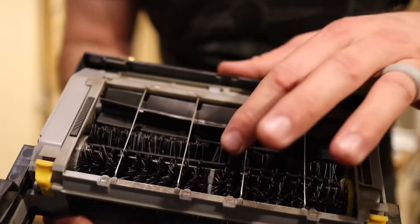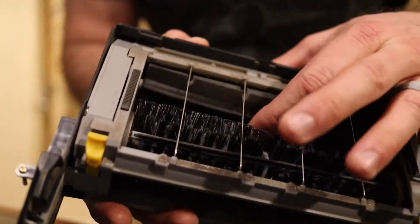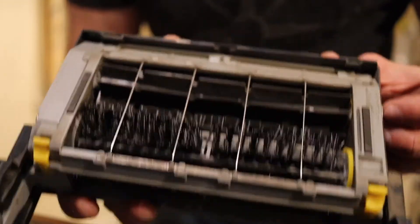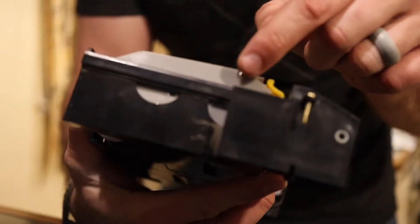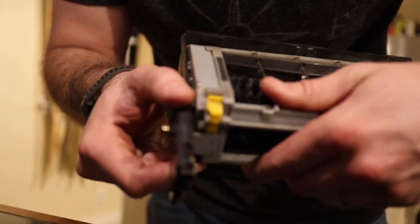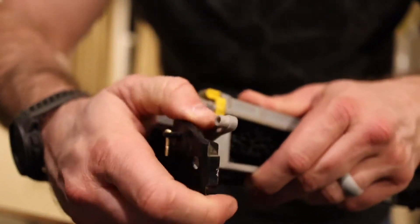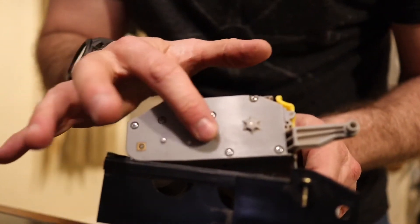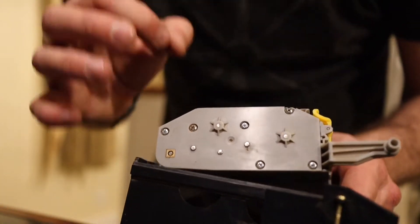So what happened to the cleaning head? I'm going to spin this so you guys can hear the noise. You guys shouldn't be hearing any noise — it should be almost dead silent. That noise is actually coming from this part right here. You can see there are a couple of screws. If you gently move this black piece here, you can expose the side of your cleaning head. That noise you're hearing is from a gearbox that's full of tiny little plastic gears.